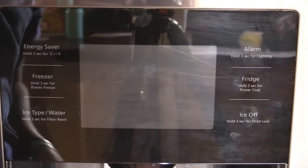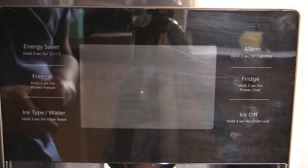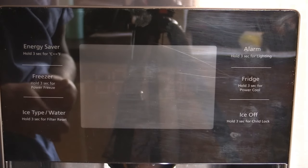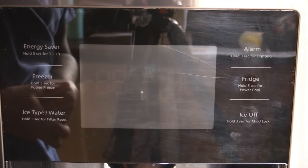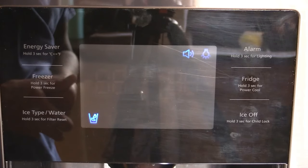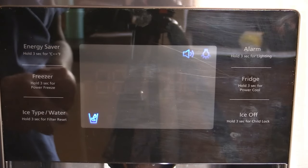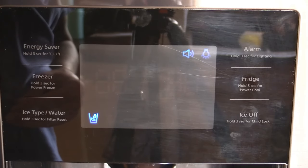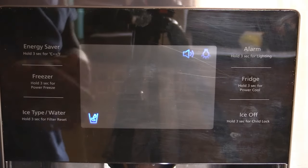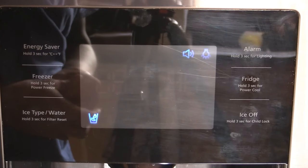We simply press it again until the screen is black. You'll hear another jingle, and the display will pop back up. Now you're out of the Forced Defrost and out of diagnostic mode. The entire time you are in diagnostic mode, it will beep. If you're wanting to defrost for the ice room, to get the ice maker out or anything like that, you can use that FD mode.